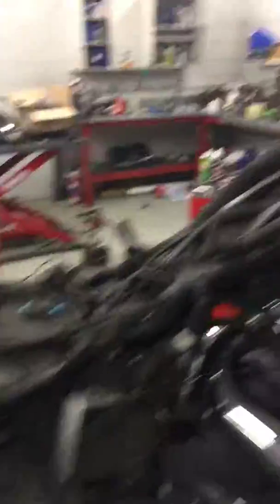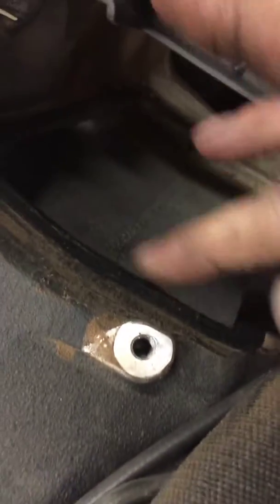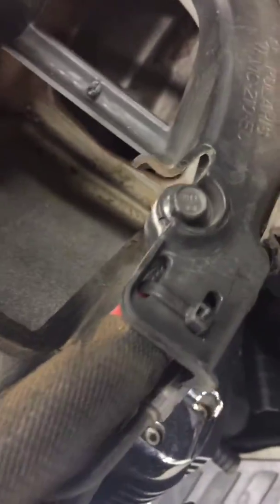At this point we have cleaned your air filter — got all that nice and clean. You can see some debris and dirt in there. We'll go ahead and vacuum that stuff out when we're in there, and we'll clean up these seals right here, that way when it mates together with the air filter it'll look good.